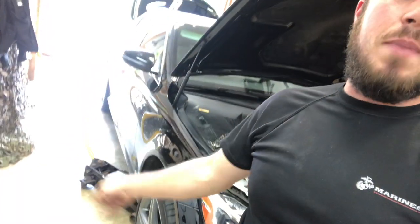All right, guys, so I jack up my car with 2 jacks, one on each side of the car. This allows me the opportunity to tilt the car one way or the other. With the drain plug being on the driver's side of the oil pan, I would like to tilt the car just a little bit to drain all that excess oil out of the bottom of the oil pan. Usually, if it's in the rear of the oil pan, when you jack up the front of the car, the oil runs directly out of the oil pan. But since I have it on the side, I like to jack it up with 2 jacks to be able to tilt the oil out of the oil pan, get any of that little residual on the bottom, any sludge, any crap. I've had really good luck with it. So there's a tip for you.